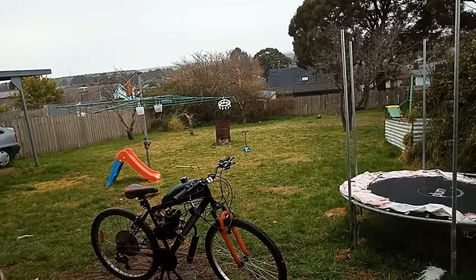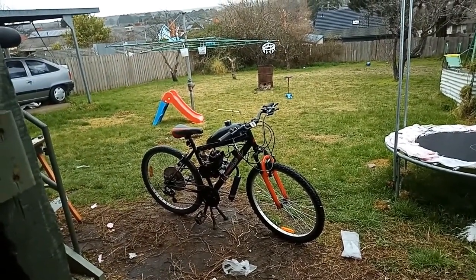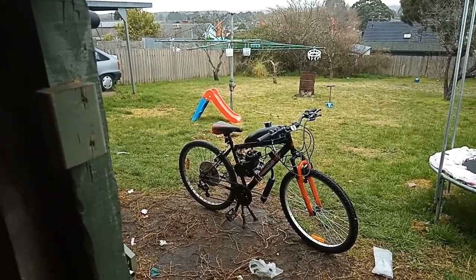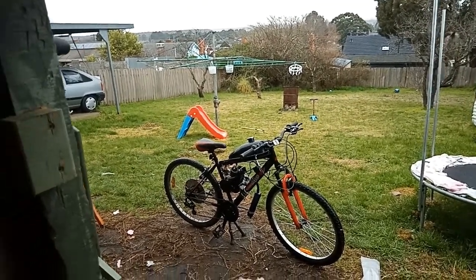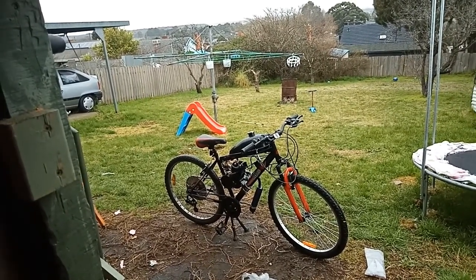That's probably because the bike is running poorly. Once it cools down and hopefully after it stops raining — I'm hiding under the house at the moment — after it cools down I'll pop that intake off and cut another gasket and get rid of that silicon goo that's on it, because that really has never worked for me.